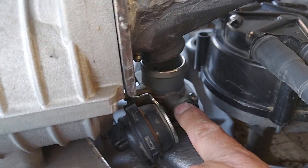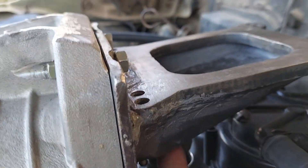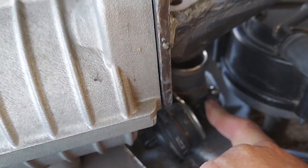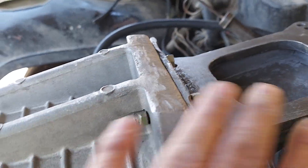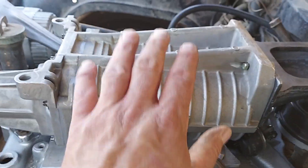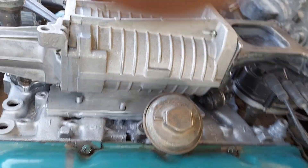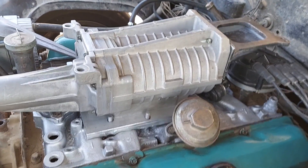I still need to run a hose from this lower bypass valve to the plenum. Basically at idle the valve is open, and when you floor it it'll close — that way all fuel and air from the carburetor gets boosted to the lower plenum. At idle the air will just be doing a loop. These superchargers flow more air than the engine needs, and if you don't have a bypass valve you get that very uneven, unstable idle with the engine constantly revving.